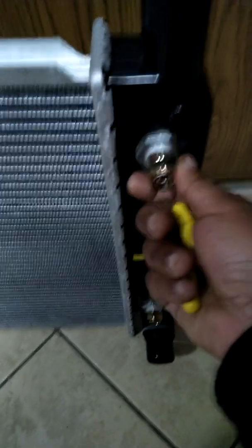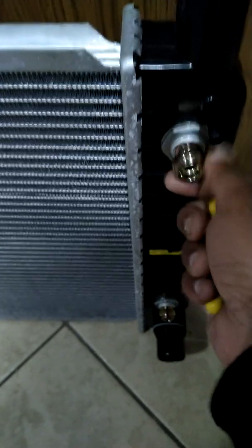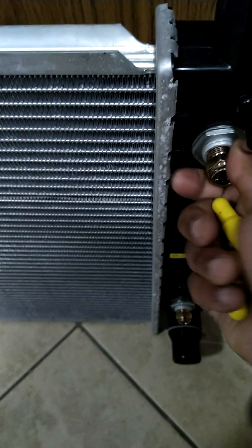Keep an eye on my next video when I'm changing the old one for the new one — you'll see how they go in. One line goes in here, the other goes in here. Down here you have the lower coolant hose — the big hose — that goes in here. On the other side you have the top coolant hose; you remove this plastic, which is just to protect the new radiator from the store, and the top coolant hose goes in there.